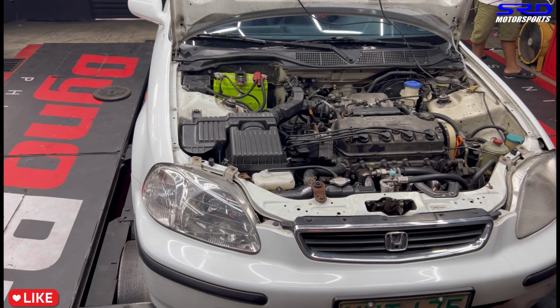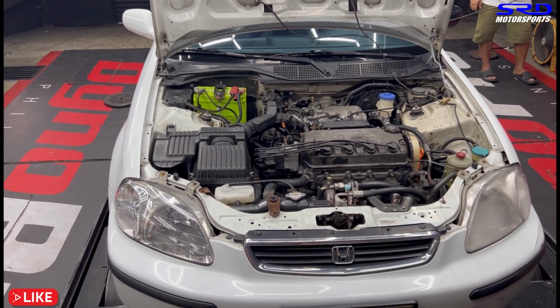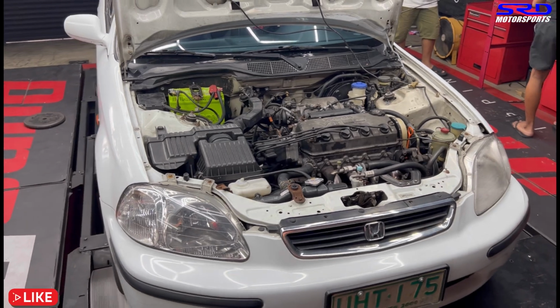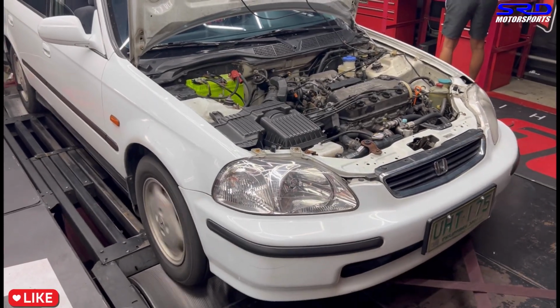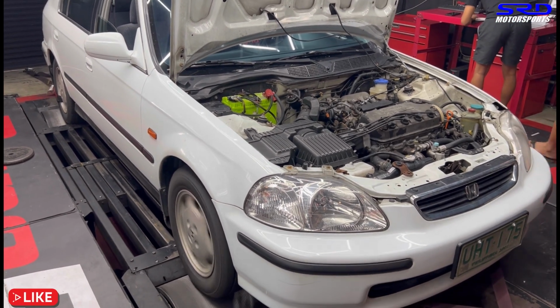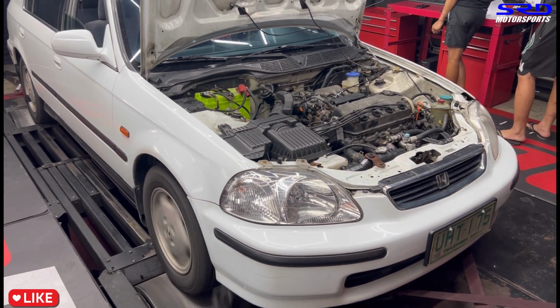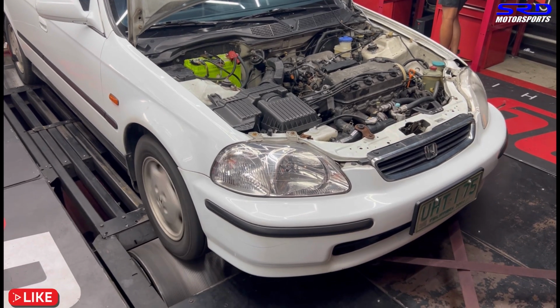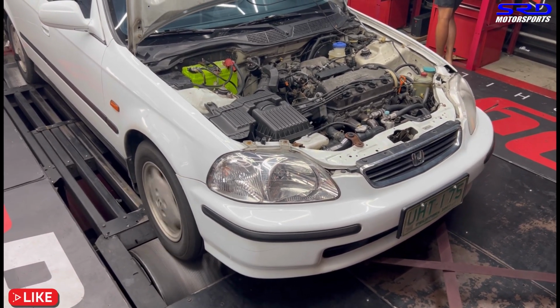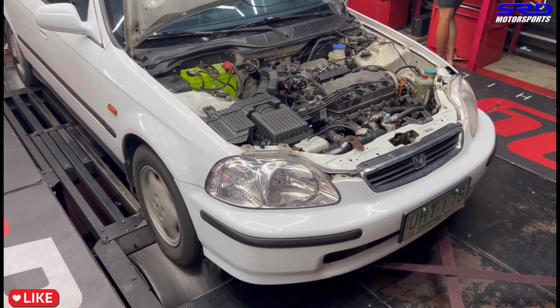But first, we start with the stock air box. All right. Car is running now. They're still double checking the calibration if it's all good and correct. And it's really good they always check this, because sometimes it's kind of off, so they can see the proper corrections. Then after that, we're all ready for the dyno run. This is really important, because the Dynojet is always consistent, granted it's operated well and maintained properly, just like Dyno Pro does. So that's why they're our choice.